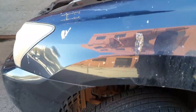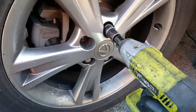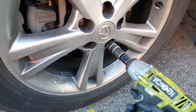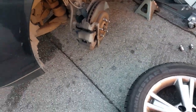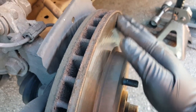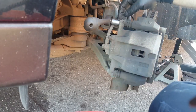I'm going to check if the car is sturdy enough — and it looks like it is. Next thing we're going to do is remove the lug nuts: that's one, two, three, four, five. We can remove the wheel and set it aside. By checking the rotor it looks fine, but it's a little bit wavy — which is still okay, not too bad. I would definitely turn it but the customer didn't want that, so we're just going to replace the front brake pads.